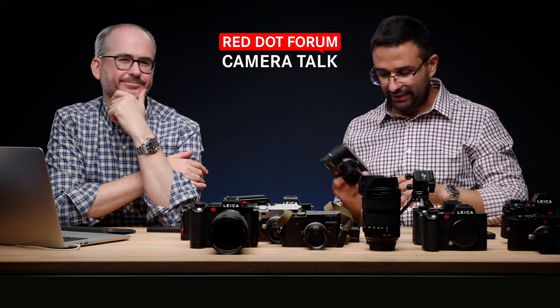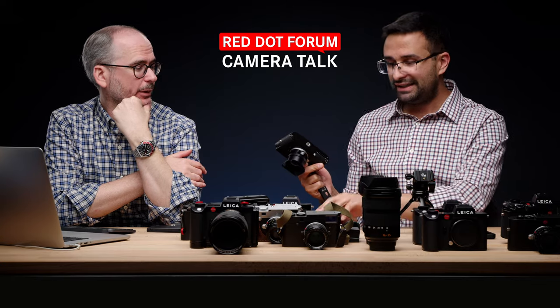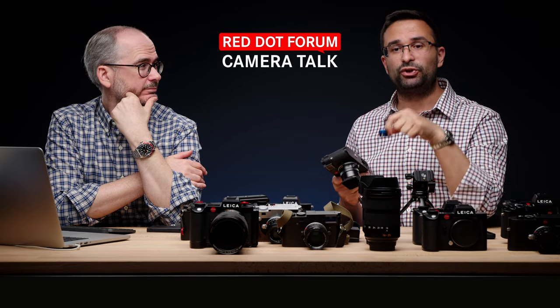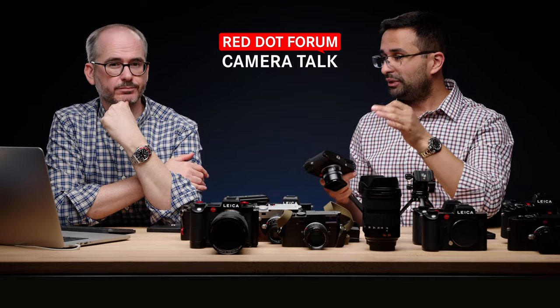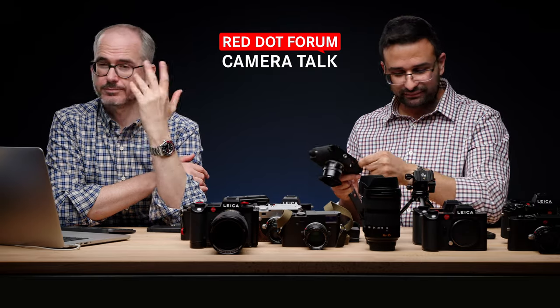First thing I'm going to do is insert the memory card that I'm going to format, which is the memory card I'm going to put the firmware on, into the camera that I'm going to update. Because what you need to do is format the SD card in the camera that you're going to update. So if you have an SL2, a Q2, and an M10, you need to reformat the card in each one of those cameras before you update that camera. Makes sense, right?